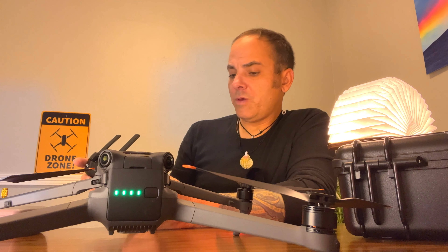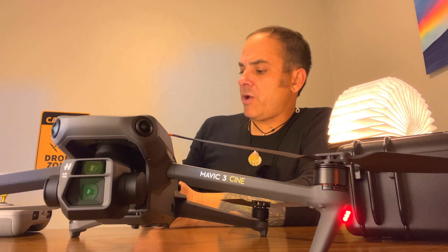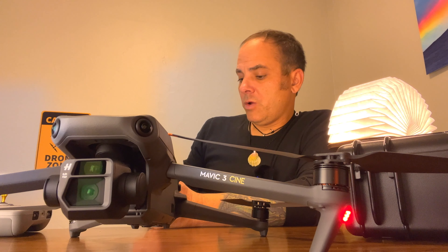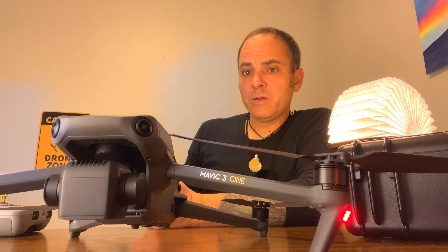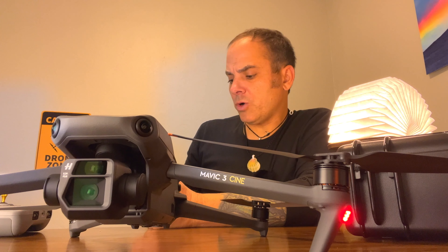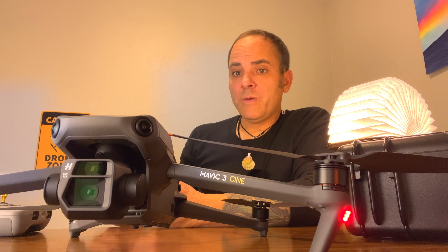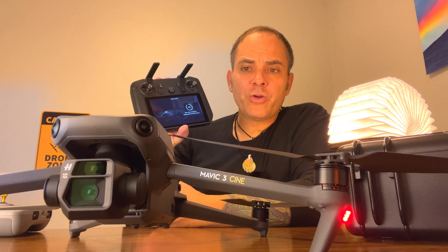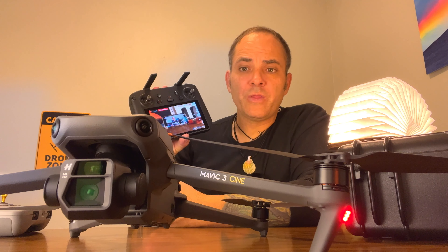I set it up so far. One thing I want to show you — I've been having little issues with my horizon. So what I can do is go into control and recenter the gimbal as an option. You can see the gimbal recentering itself. Then go to gimbal calibration, go to auto, and let it do its thing automatically through the fly app. I always suggest before any good flight, have the gimbal on a level surface and calibrate it automatically. That should eliminate any issues you may encounter while flying.